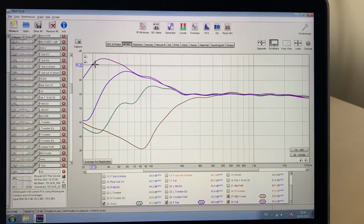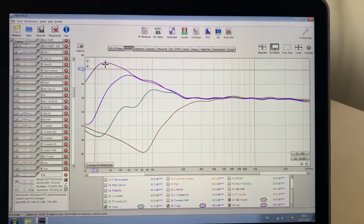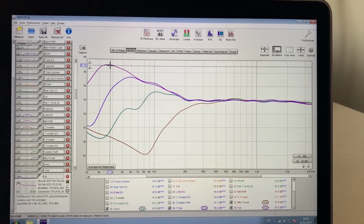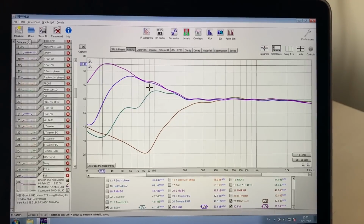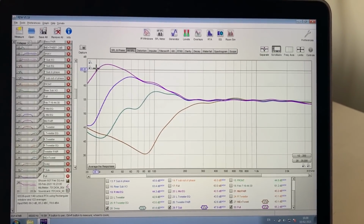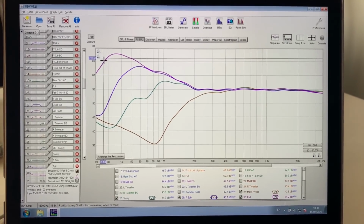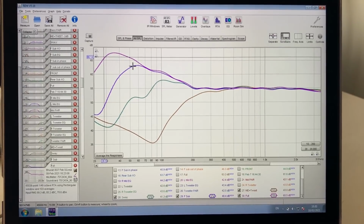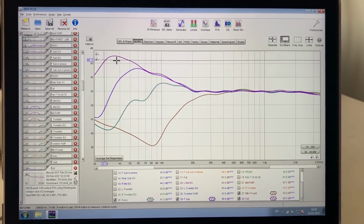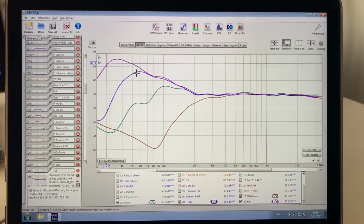So after the rear sub was also crossed at 40, 24 dB, timed, in phase, bang, it just gives that extra low end and it's functional down to 30, 28. Yes, it's not a crazy IB sub like I build in many cars, but it definitely gives extra depth, which is needed. And they play beautifully together. The rear sub disappears, and you hear everything from the top of the dash.